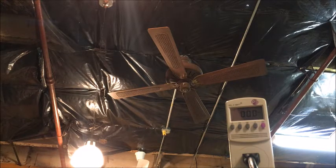This first one I have here is this Thomas Industries fan, which essentially looks a lot like, it practically is, a Fasco Parlor fan. It's got the same vents, and it's got the variable speed. The way the variable speed works is the pull chain has straight high, and then what's called variable medium, so you can go up to a medium high, just a hair shy of high, and down to a very low speed. So that's variable medium and off.